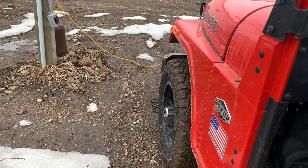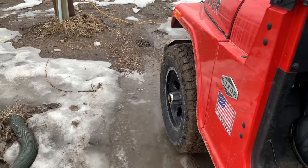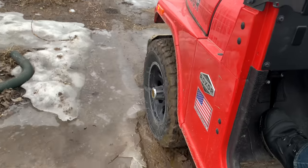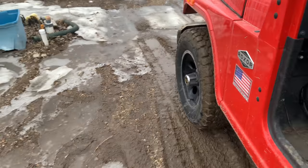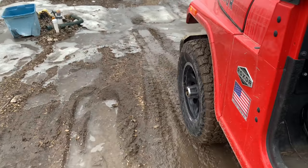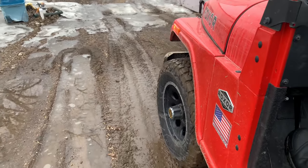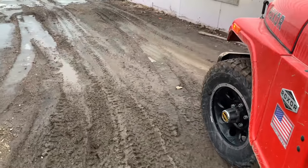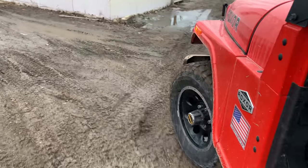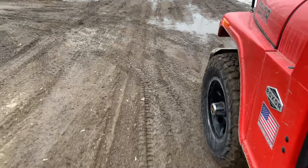After doing the cleaning and trim, the way you do the burn-off after you take off that plug — I inadvertently edited that part out — but you just step on the gas and rev it up repeatedly. For mine I didn't get any soot out, which is a bit unusual, but I do have a hot tune on it — just to remind you guys.